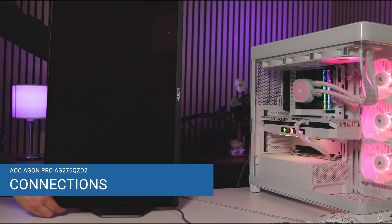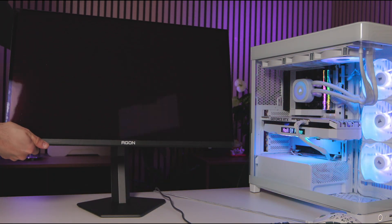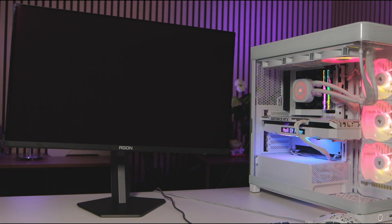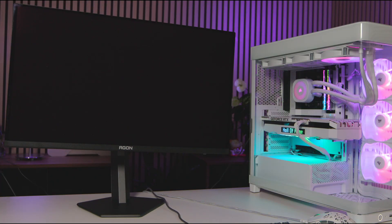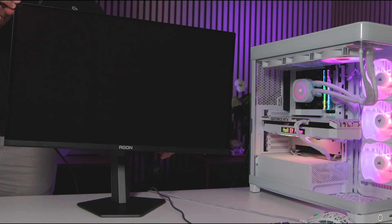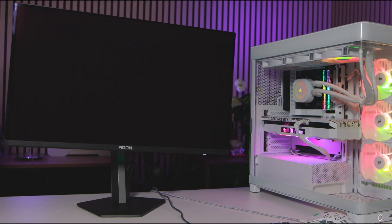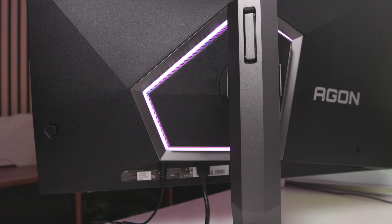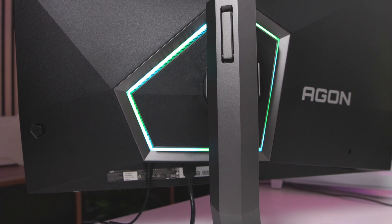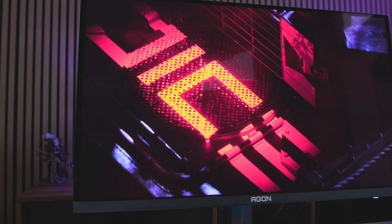The monitor offers a lavish array of video inputs: two HDMI 2.0 ports and two DisplayPort 1.4 ports. Such a four-fold configuration is rare and offers a lot of flexibility. The connections are positioned at the bottom on the back, with the downward clearance not being too generous, which causes cables to bend quite strongly. Additionally, there's a USB 3.0 hub, which however only offers two USB-A downstream ports via a USB-B upstream cable. A KVM switch is missing. The whole thing is completed by a 3.5mm jack line-out for headphones, and power is supplied via barrel jack with an external power supply unit delivering a maximum of 134W. Solid connection diversity, but the USB hub is somewhat meager with only two outputs and the lack of a KVM.